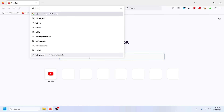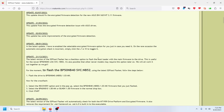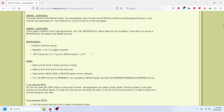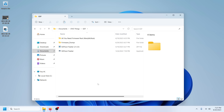Now onto the software. What we're looking for is SDF Tools — specifically the thread dedicated to it on the MakeMKV forums. You can read through all the detail there about which drives can be flashed and which can't. What you're going to want is the flasher tool itself — SDF Tool Flasher — and the all-you-need firmware pack, which contains every firmware possible for every drive. As luck would have it, I've already downloaded those.